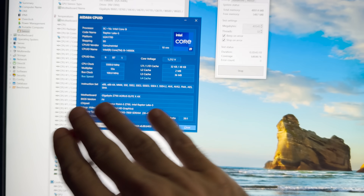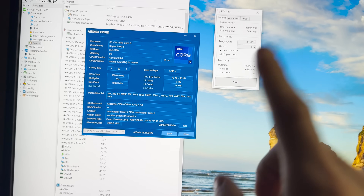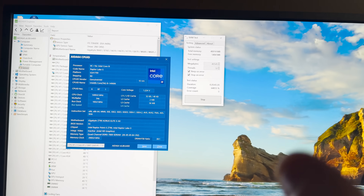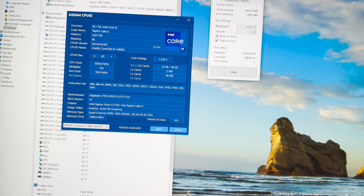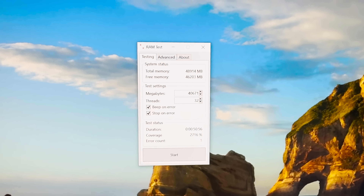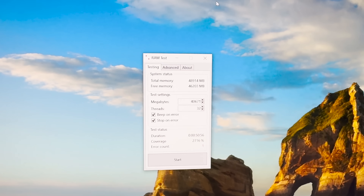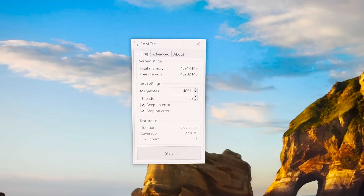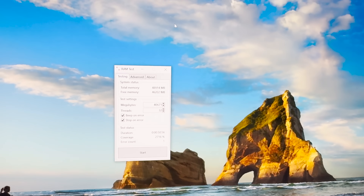Now that I know 7800 works, I'm going to try 8000 one more time. I don't want to spend too much time on it, but 7800 — thumbs up. So this is the best 4-DIMM motherboard you can get, for sure. It's the next day again. I can only get it to about an hour stable, so it's a no-go on 8000. But 7800 is A-OK.